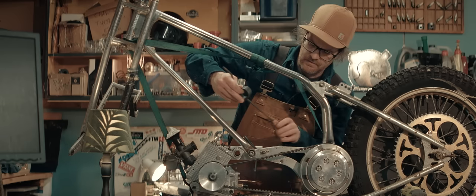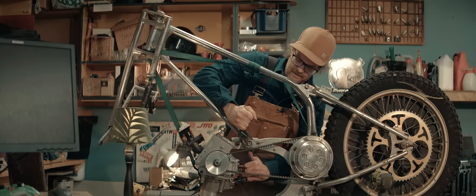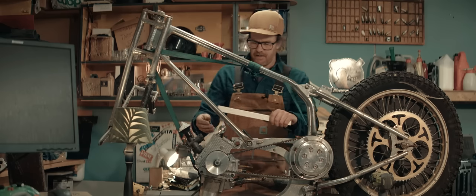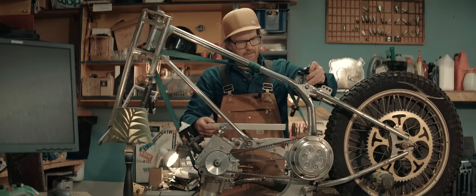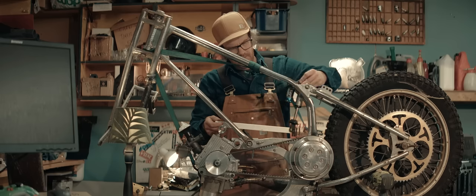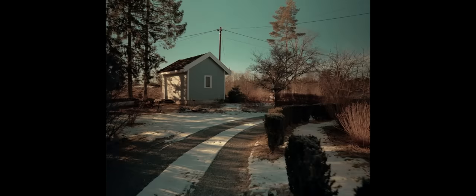So this is connected to the engine, can slide up and down. It bends like this, like the engine bends it. That would be simple, but this is probably not stiff enough. I thought about making a kind of lever arm here and then having that spring mounted here. There's lots of room and this would provide more adjustability. You can move the spring and change the angle of attack on both ends.